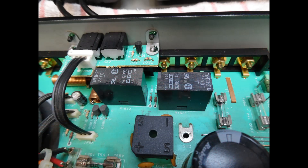I want to touch on the issue regarding intermittent loss of sound, which I've described in many tutorial videos. A common issue is that the relay contacts used to switch audio through to the speaker terminals or binding posts become oxidized and resistive. What you find is if the audio is low, or from time to time when you turn the amplifier on and off, you get intermittent loss of sound because the voltage and current can't overcome the resistance.